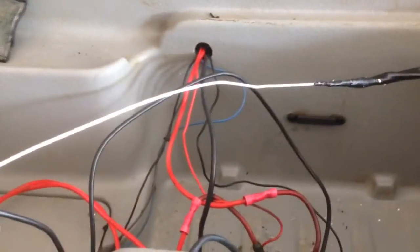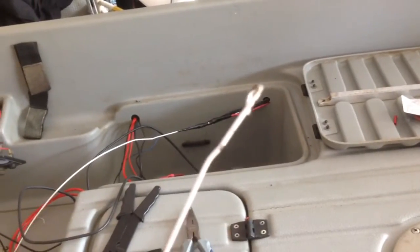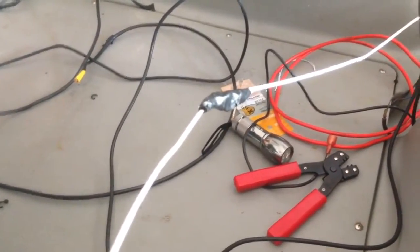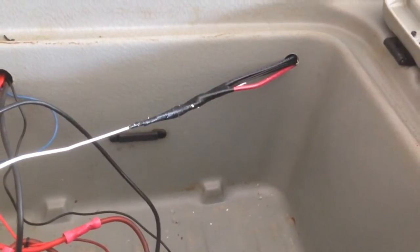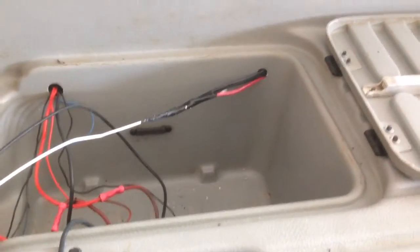They come out right there where they feed to the battery. So if you have this problem as well, what you can do is I took two coat hangers and I cut them up, spliced them together right there, and I pulled the corners down so that they're as small as possible. I had these two coat hangers run together and then on the end there, I taped all the cables that I need plus one extra — the smallest one first, then the black one, and then the red ones after that.